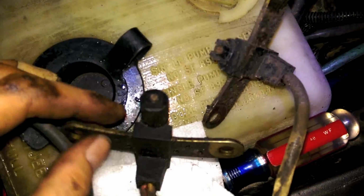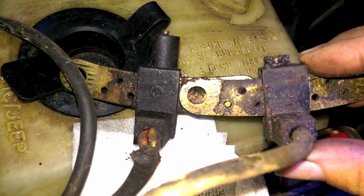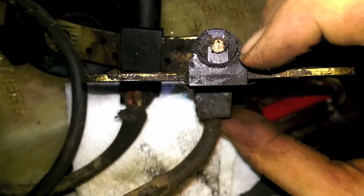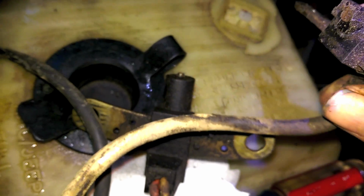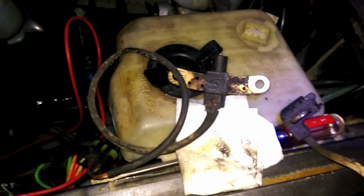Upon further inspection of the crankshaft position sensor, if these are the exact same makes, you know, like body styles, they're not different from different countries, companies, whatnot. This one looks like part of it got snapped off. The tip was damaged. It's not round. I guess it kind of looks like a crack. So I think that is our problem. So let's see if we can fish that other bolt out and put this old sensor back in.